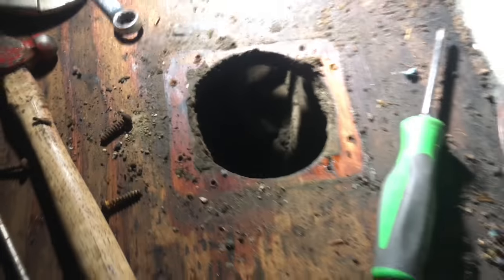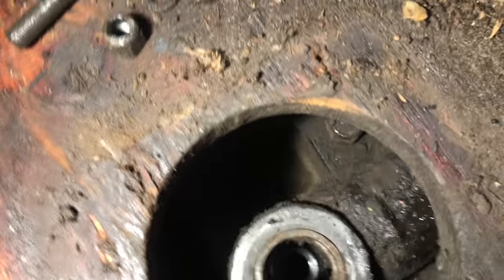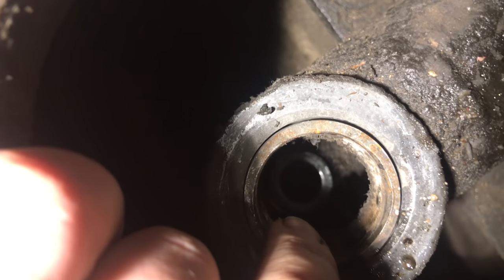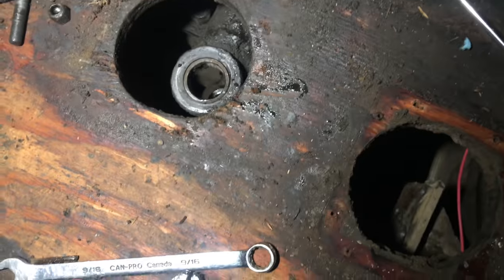Here's what I'm working with now - the floor is torn out. This is how the main stick works: this first bit is the suspension for the whole assembly, then the first ball sits in this little ring here, and way down in there is the little arm that pulls on the shift forks. Of course this hole is just empty, straight to the ground. That's the mounting bracket on it there, and there are the two forks. I'll get this closed up - I need new shift boots, and the screws came out fairly easily with nice sharp screwdrivers.